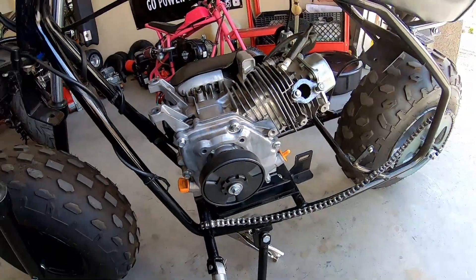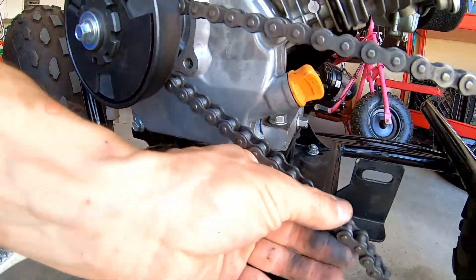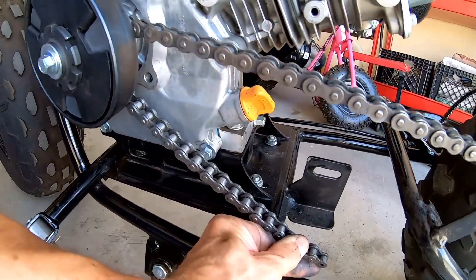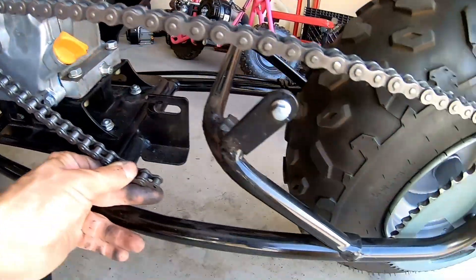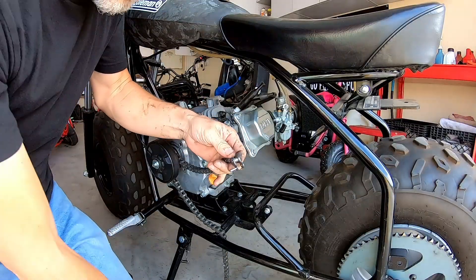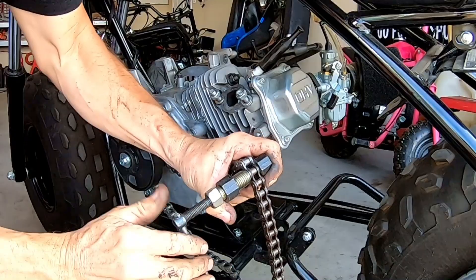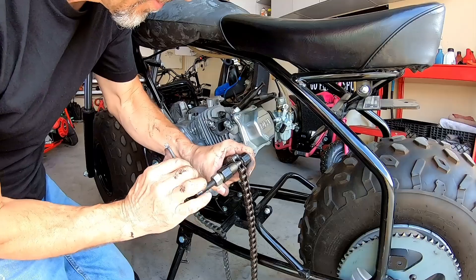That'll work. I can take off the riser mount for the torque converter to run the straight chain — it'll run without it, but I might as well just leave it on there so that in case I ever want to run a torque converter again it's just an easy swap, since the engine's already raised up and everything clears. Now I'll go ahead and hook a couple of pieces of chain together. What's cool is I don't have to use master links — I can just put it together with the chain breaker.